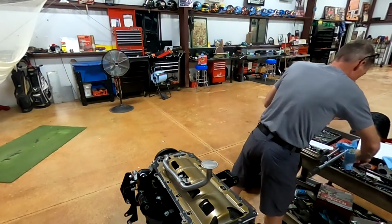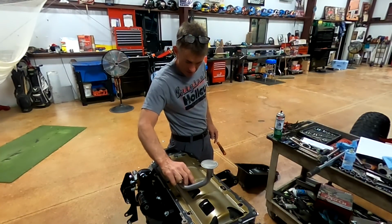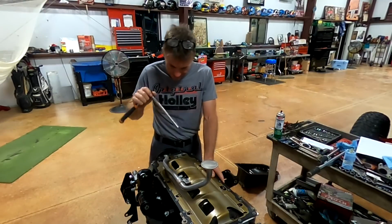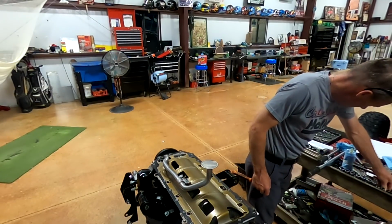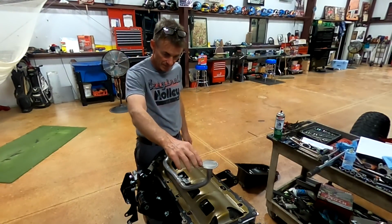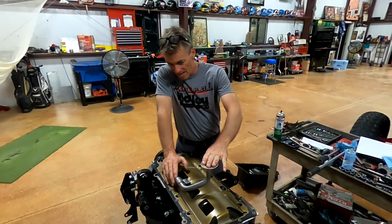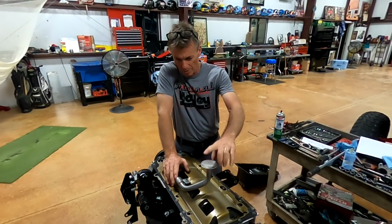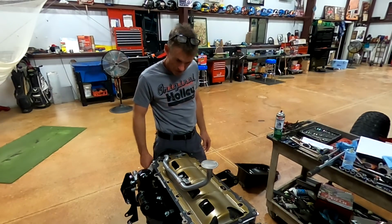Again, not final tightening, none of that. What we are going to do here, and I saw this with our buddies on Finnegan's Garage, Mike Finnegan and David Newbern, and every now and then old wild man Mike Cotton, while they were battling, trying to get an LS motor into their jet boat. You got to measure from here to here, and then that same depth on the oil pan. I think it needs to be around 3/8, somewhere in there, from the bottom of the oil pan to the pickup. You need a little bit of room, but not too much. Now I got to figure out how to measure that up right quick, and that's what we're fixing to do.